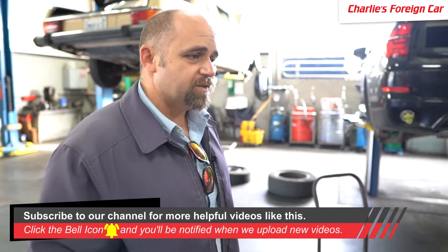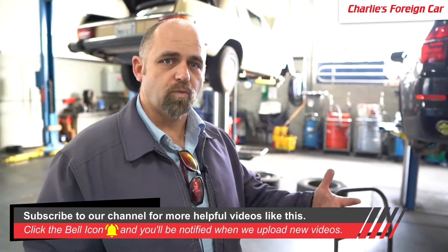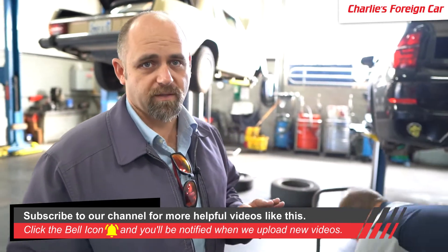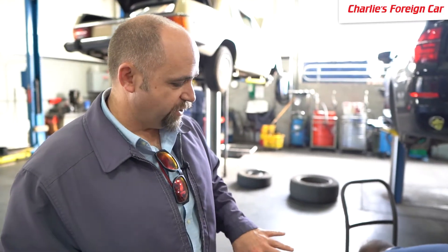Our hopes with this one is to get rid of our 14-volt low-voltage code, as well as reset all the lights and see if we can get the EV operation working again on this car. The car came in under gasoline power only, so we're trying to get the hybrid portion of this vehicle working again with just a new 14-volt battery. It said replace the EV battery pack, but we're not going to do that just yet until we know that this battery is good.